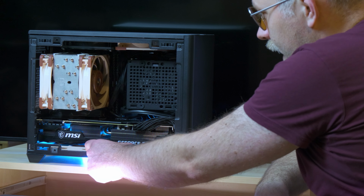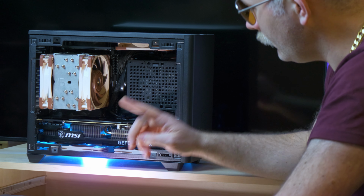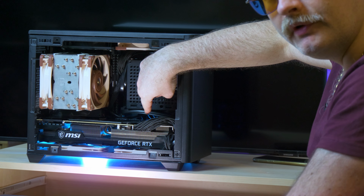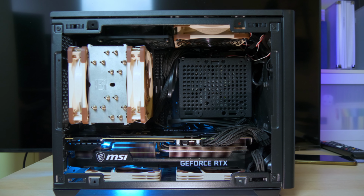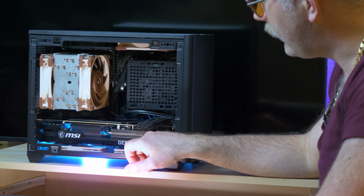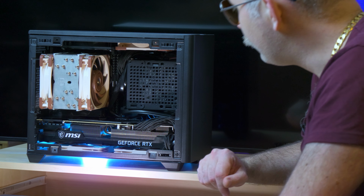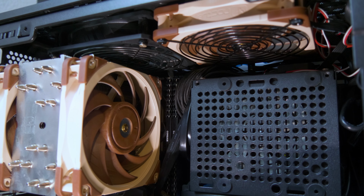So basically these bottom fans are intaking the air from the bottom. And keep in mind, this Ventus 3090 GPU is not a pass-through. It doesn't have a pass-through fan blowing hot air inside the case. All the hot air is being exhausted sideways, basically through the fins over here and from the other side. So basically this card is not a pass-through radiator design.